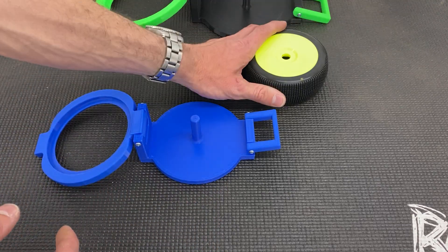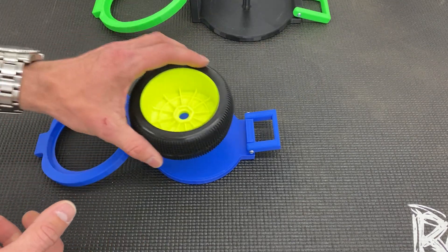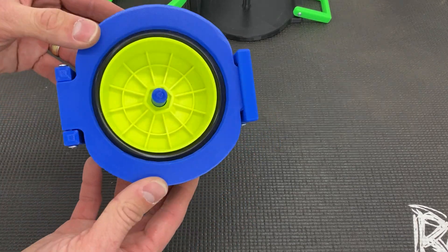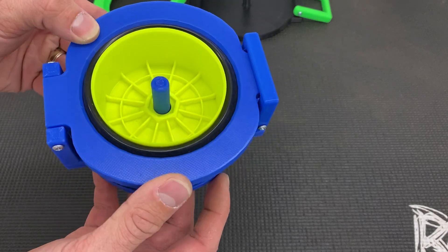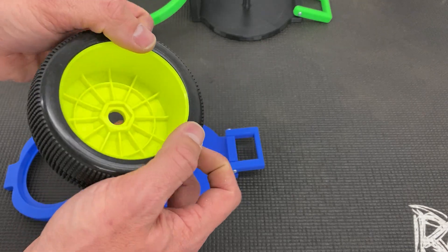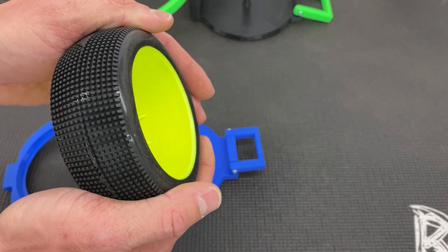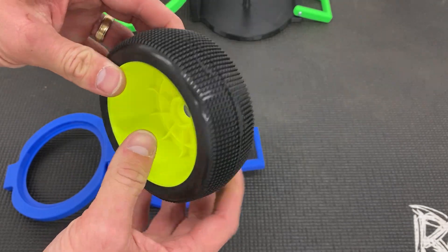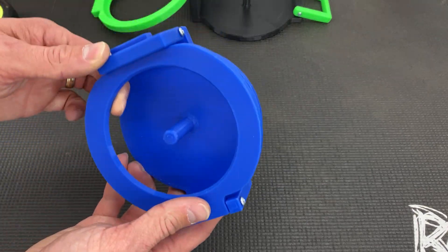After you get the glue in there, go ahead and put your tire band on and set it to the side. Then you clean off your bead — same process on the reverse side. Put it down, get it clamped, the jig will crimp the tire down so you can get into the bead, run your glue bead, then release the clamp. The tire contracts back around the wheel and you have a nice evenly dispersed gluing surface inside the bead of the wheel.